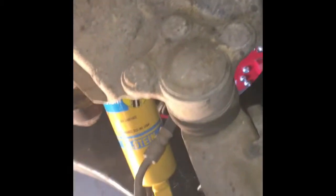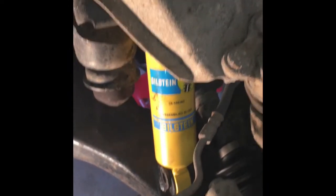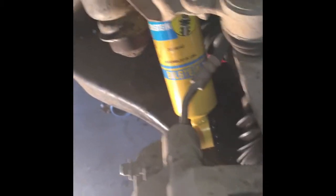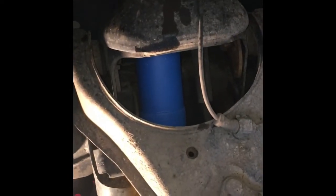At this point we want to insert it back into where it goes — there's a slot up there. We put it in; this side was considerably easier than the left side. From here, nipple side down, and the washer concave down. From this point we want to try to tighten the new nut just a little bit — in this case they sent us a 17mm nut. Just get it on there a little bit.